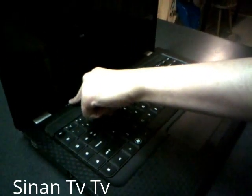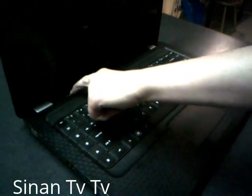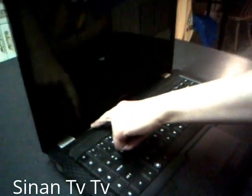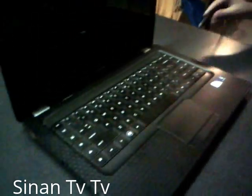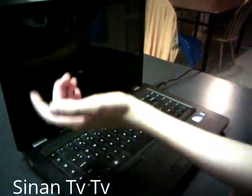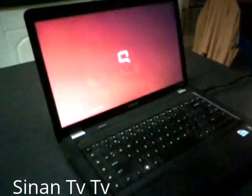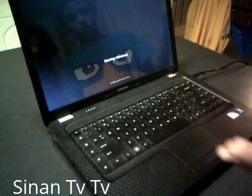Here's the second most important thing people get wrong. After you take the battery out and you've held the power button down for 30 seconds to one minute, don't put the battery back in yet. Just plug in the adapter. Now go ahead and press the power button just normally and see what happens. There you go.